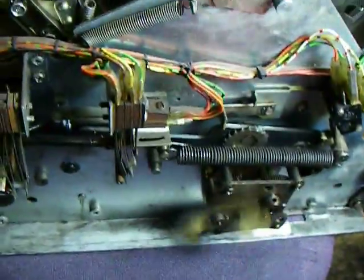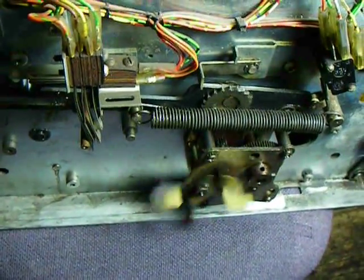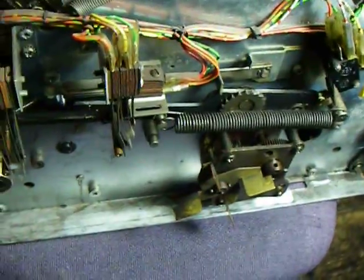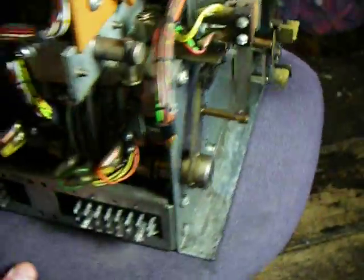There's a cam mechanism controlled by this air brake, which is quite cute — it's kind of from the clockwork era, used in clocks to control speed. And that basically acts as a soft damper to stop the reels sequentially.